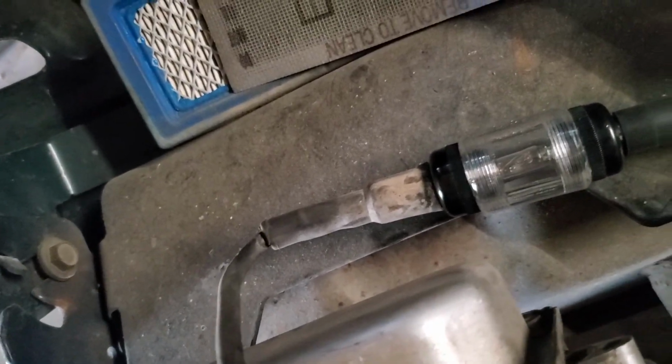On that video outside, it was a little hard to see it on the Waverunner, so I went ahead and brought it in here on a riding mower. It's real easy to see. It's just a little easier to see that light, so you can see how to test it. You put the one tester in on your spark plug wire, and then the other one leads right into your spark plug. Then when you turn the key, you can see that light real easy on this.